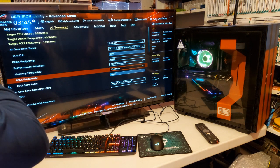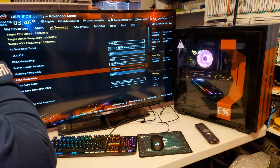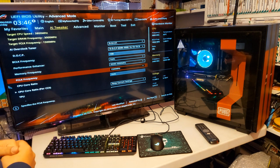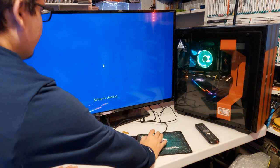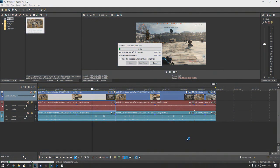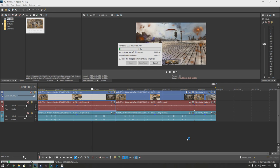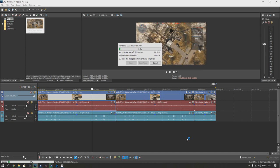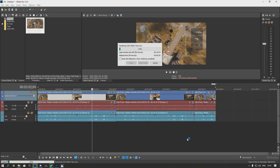I believe 1500 MHz — which is half of the 3000 — will get you the best performance. We can do tests; it's not going to break anything. If anything happens, it will just be a quick shutdown as a safety procedure to avoid damage. That should be good — I think that's about right for AMD to get maximum performance. Make sure DOCP is enabled, which is the equivalent of Intel's XMP profile for your memory to run at full speed. We did have some issues with DOCP enabled getting a full 3000 MHz. Apparently AMD is very finicky with the memory kits it's fully compatible with. I've got the T-Force Vulkan memory, 16GB DDR4 at 3000 MHz, which probably isn't fully supported with the new AMD architecture. It is running stable with DOCP off.